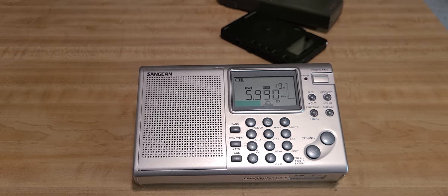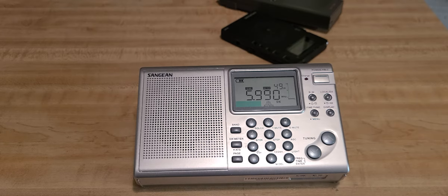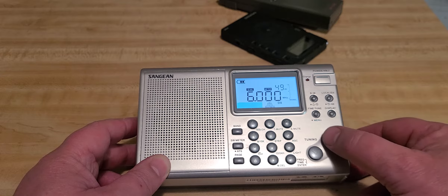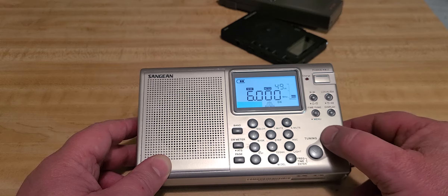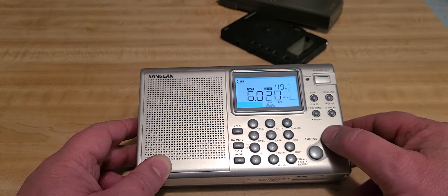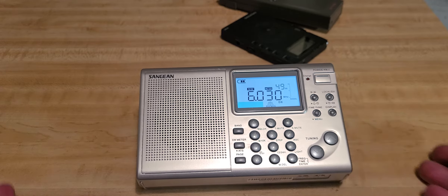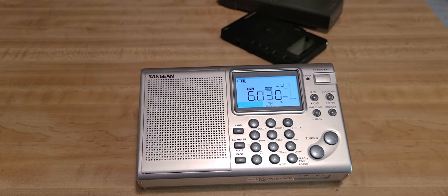It has several bandwidths. Would I recommend this radio? I think there are so much better choices out there right now, like the Tecsun PL-330. This one also mutes when tuning, and it doesn't have a tuning knob — you have to tune by the up/down buttons. It doesn't mute that much, but it mutes enough. And it doesn't have single sideband, which makes this a radio that, for the price it's sold at, you have so much more choice out there.